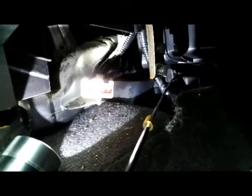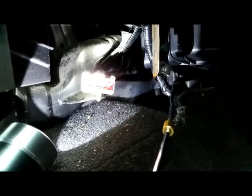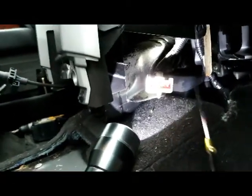And that's the prize. I've got my little noise stethoscope here, and I'm hearing the knocking right through the rod there at the unit, the blend door valve. So I just got to finish getting access here. My plan is to pop out these other vents here just to give me a little more clearance, and maybe I'll get a little luckier than some of the other videos on this topic.